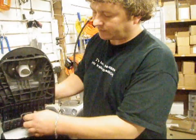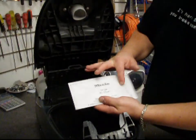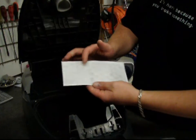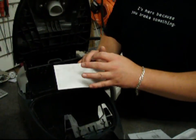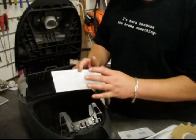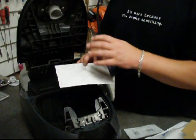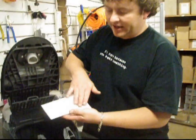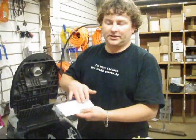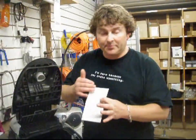The other filter here is your Miele proper filter. This side should always stay clean — always be looking on the underside here. If you end up with too much black, carbon-like material, or if the filter gets blocked up with material like hair, cotton, or lint, it means that something is going wrong. Because you shouldn't get any chunky material on this part of the filter. If you're looking here and you've got something that is not just simple carbon, there's something else going wrong.